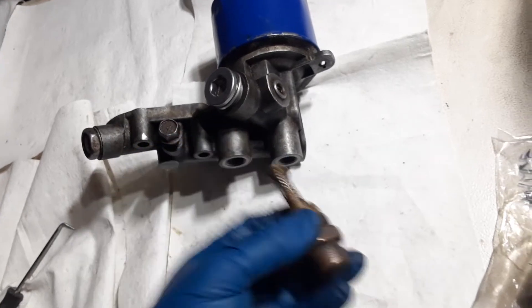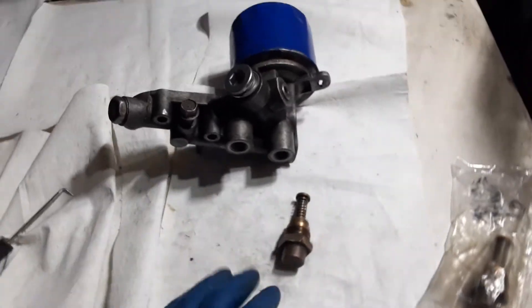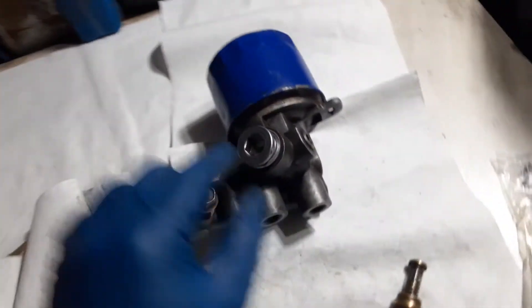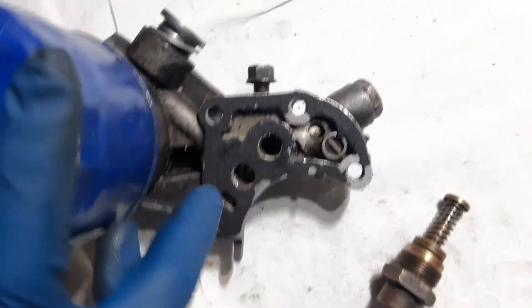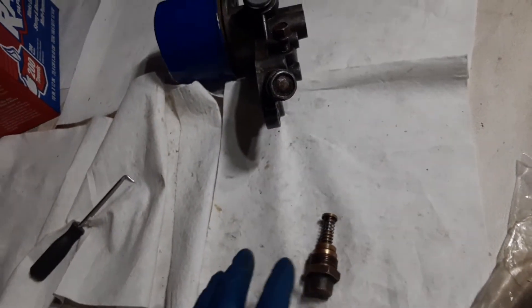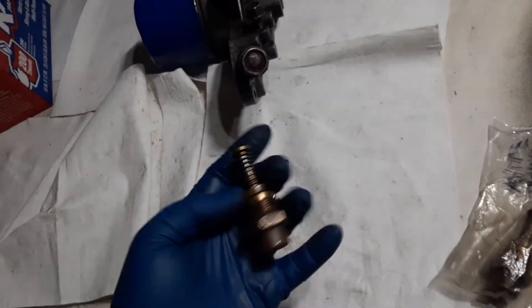Opportunity came up and I saw this on the engine that I just purchased, and I thought other people are going to make this mistake again. Hopefully if anybody sees this, they won't mess up their engine. I've heard some people have had rod bearing issues because of it. The oil pressure goes all the way back to the head and everything else from this port right here after it's filtered. It's definitely going to cause issues eventually — if you ever get to a point where this extends all the way, it's going to have an oil loss problem.